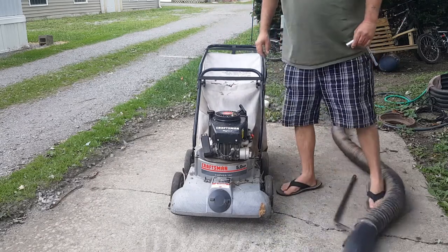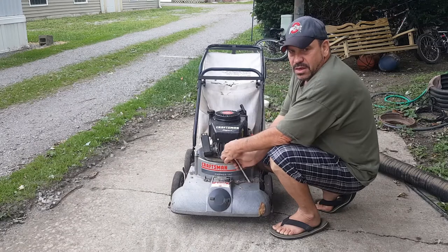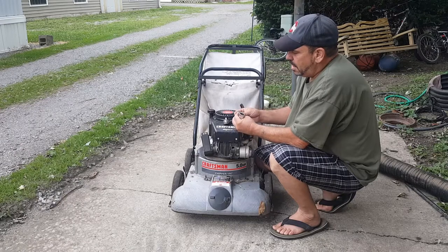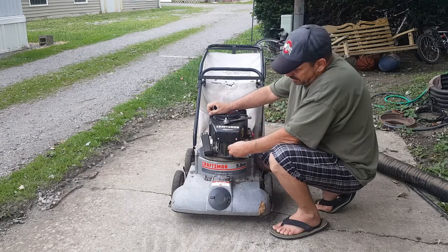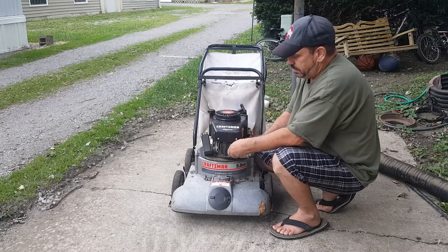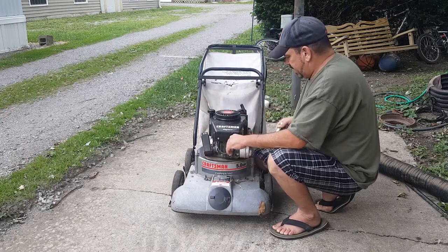One of the things I like to do is get as many of the leaves off it as I can. Let me take this off and take the plug out to check the condition. The plug looks pretty healthy - it's not nasty or dirty. For an initial start I don't even think I'm going to clean that plug. The plug is a J19LM. I don't know if I have one in stock, but if I do I'll put a new one in.